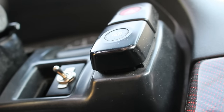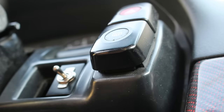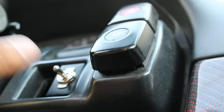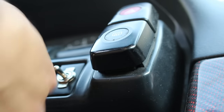Not sure how this camera angle is going to work out, but the handbrake is currently holding the whole camera up — it's working pretty solid. So what I'm going to do is just string all your wiring through here. I'm going to put that into a butt connector, and I'm going to cut the one that's on there off. This is just your solid little ground piece that I'm going to bolt up to the chassis and string these both through. The tough part is getting the wires out — that's the tricky part.